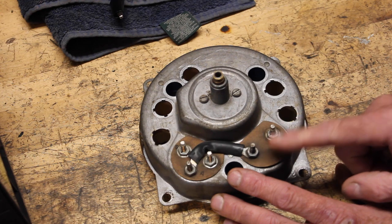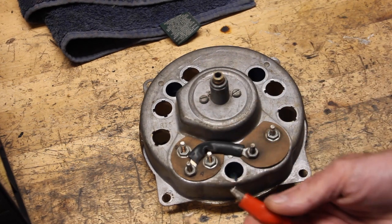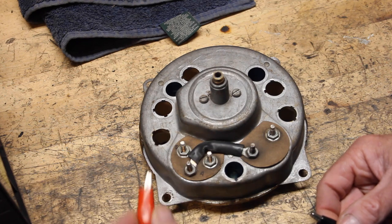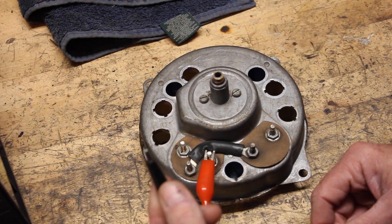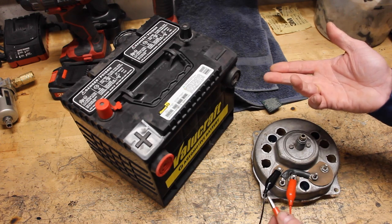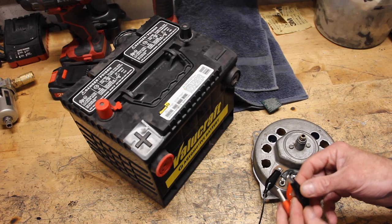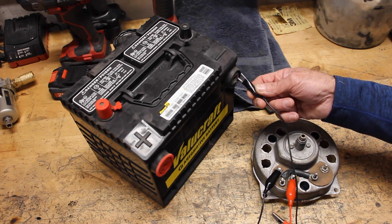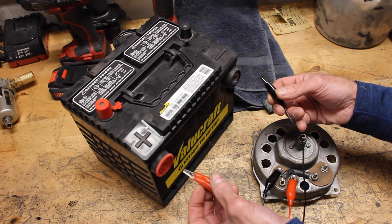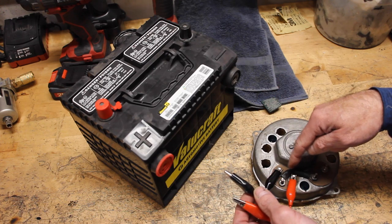It's a real easy way to test if your fuel gauge or temp gauge are still good as far as receiving power. Get two alligator clip test leads. Take the positive and connect it to the I post. Take the black one and connect it to the sending unit post. Then take a car battery — hopefully you have one lying around, or you could do this in the engine bay. Connect the black to the negative post on the battery and the red to the positive. You're only going to want to do this for maybe a half second — a second at best — because to burn up this fuel gauge takes about two seconds.